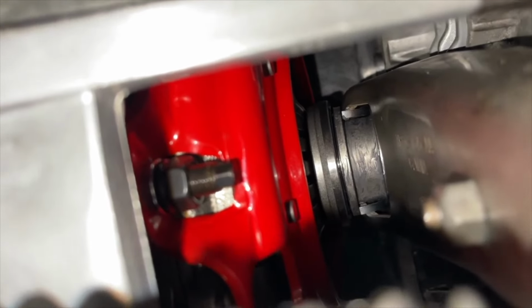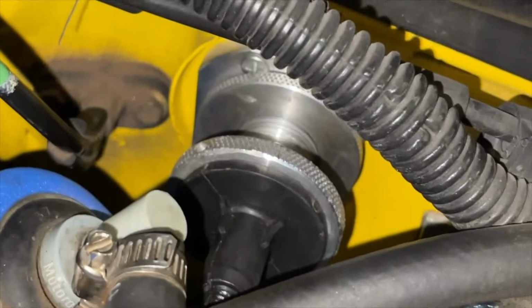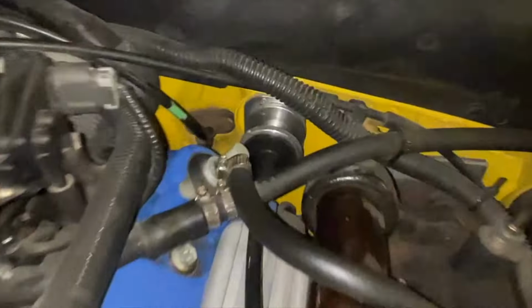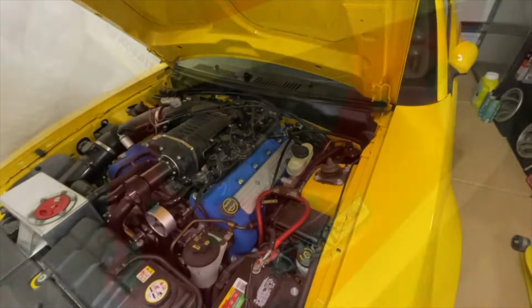We ended up with about 3 millimeters, so that as that clutch grows, you're not stuck with the throwout bearing not able to retract. Now, of course, we won't have that much slop in the end. We're going to use our firewall adjuster to adjust that slack out of it when it's all done, but we want to have that room to grow.